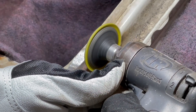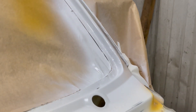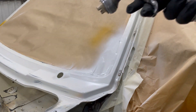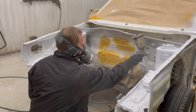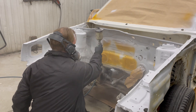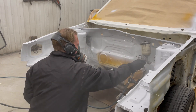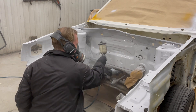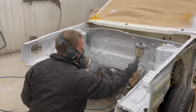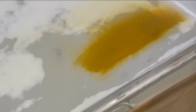We'll have to see about the lower section later on. Now I will apply some filler on the other areas that I have done some sanding to. You can also see it is much faster now because I have a lot more thinner in the filler — this is the last coating I put on with filler. Here were some dents on the roof, so I took care of those before painting everything.